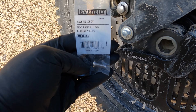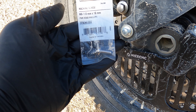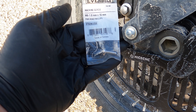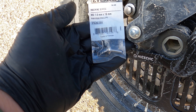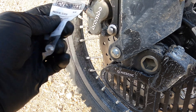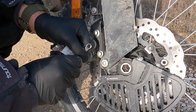We're going to replace this bolt with a pan head — it's going to be an M6 by 16 millimeters long. With the pan head, we now have a curved surface offering us the capability to glance off a rock rather than strike it with an offset 90-degree angle from the fork. Let's go ahead and put this in using an eight millimeter to remove the bolt.